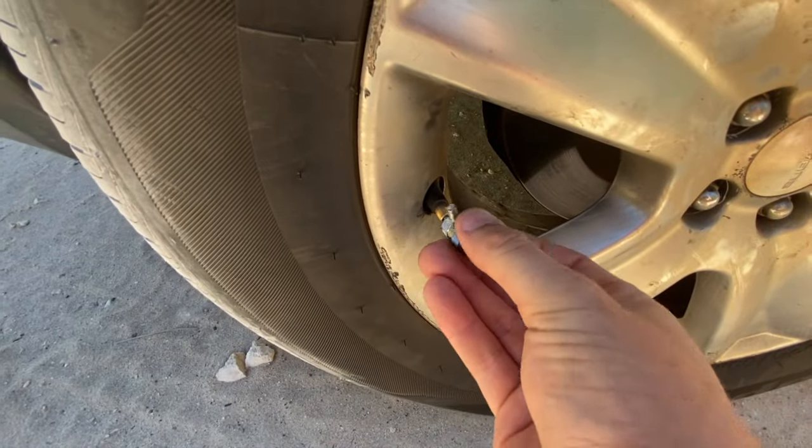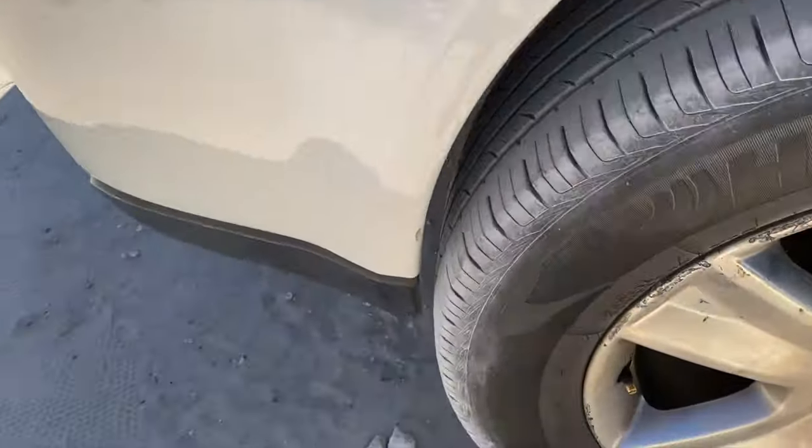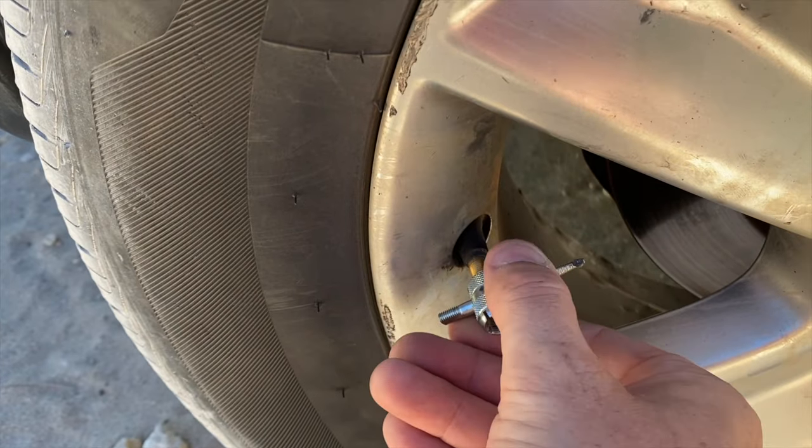Another good way, which is almost as cheap, is getting your valve stem remover and just walking around to all the tires, nipping the valve stem out just slightly until it starts hissing. I like to get down to about 10 psi, especially for a lightweight vehicle like this. You've got to factor in the weight of the vehicle and how much it pushes down on the tires and how much they balloon out. On a really lightweight vehicle like the Subaru Outback or Subaru Forester, 10 psi is good. If you've got a heavier vehicle, you might want to go a little bit higher. When you're happy with it, come back in with the valve stem remover, turn to the right, nip it back up, check the psi, and away you go.